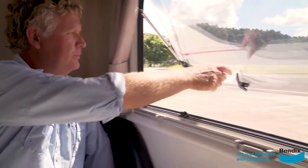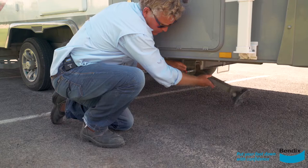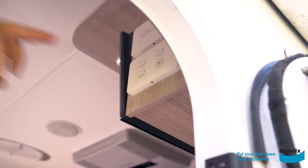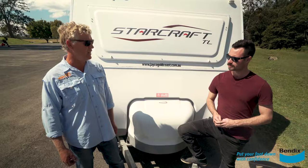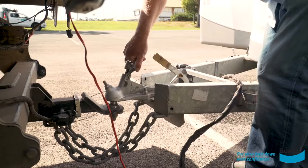Well there's plenty of things. First of all you'd probably jump in the caravan and lock everything up, secure it — windows closed, hatches closed, all those kinds of things. You'll jump out, walk around the caravan, make sure you've lifted up the stabiliser legs, got the wheel chocks removed, disconnect your gas or change the gas over, and disconnect the electrics and water. Then you'll hitch up the trailer first of all — that's the number one thing — make sure you've got that hitched on correctly.